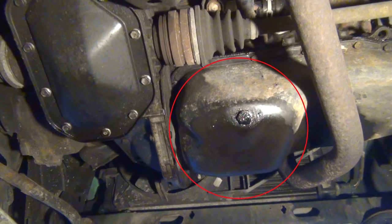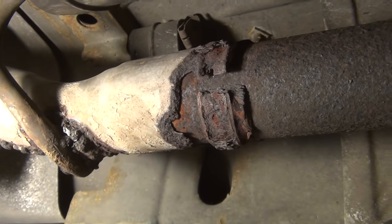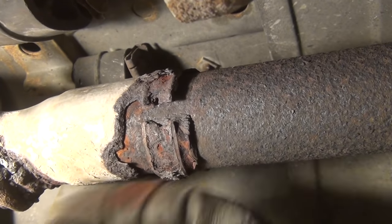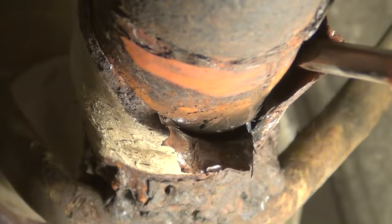By the way, here you can see that the engine has been losing quite some oil — not a good sign, but fairly typical with old Corsas like this one. Even now that I have direct access to the front end of the exhaust pipe, I cannot pull it off the converter — it simply sits too tight. Therefore, I decided to cut the pipe, widen it by force and then pull it off.